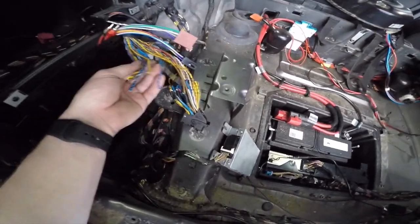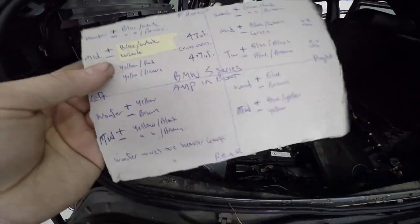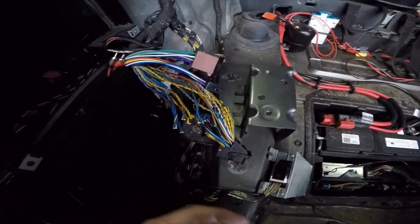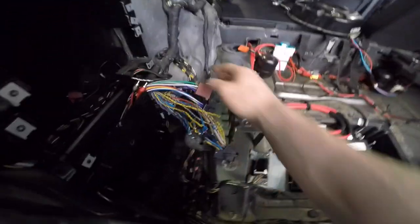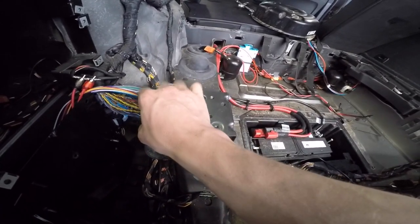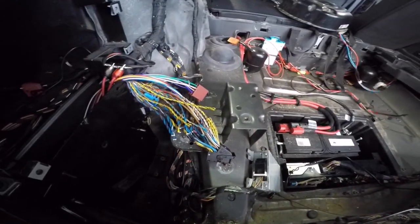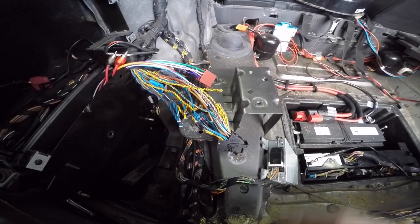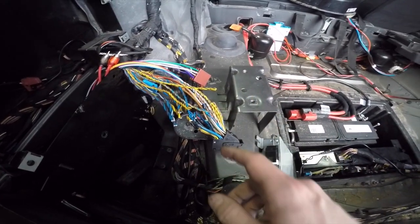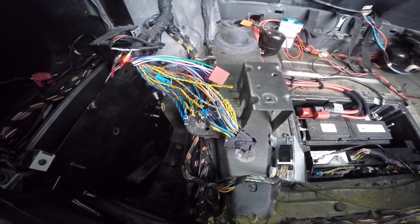So what I'm doing now is figuring out what wires in the amplifier loom do what. I was in the process of doing some testing and popping to figure out what did what, and Grant actually remembered he had a cheat sheet from when he did a BMW 3 Series — where he wrote down all the wires and their colours. It turns out on the X5 the wires are all exactly the same as the 3 Series, so that's fortunate. Now I'm just going to wire the speaker wires up to the woofer and tweeter wires. This amplifier was active, so it had separate output channels for the tweeters and woofers. That means I'm going to have to put some capacitors in line with each tweeter, because you can't be putting full range through the tweeters or you'll blow them. I'll wire a capacitor onto one wire of each tweeter and put them in parallel with the woofer wires and connect them up to the ISO lead.